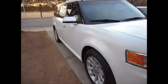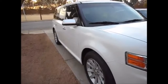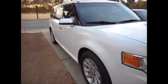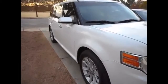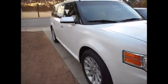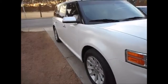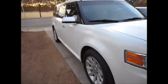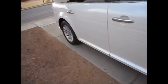When I go to replace tires, I think about tread depth. I don't wait until they're completely worn out — I replace them when there are one or two millimeters of life left, because studies show braking performance decreases significantly the closer you get to the wear lines. I'm in Arizona where it gets very hot and dry, so I do not keep tires older than four years. They dry out, start to dry rot, and become a hazard on the road.